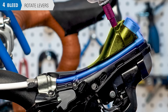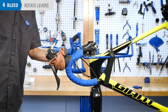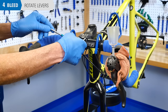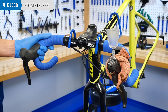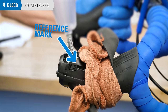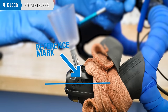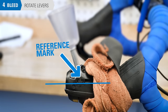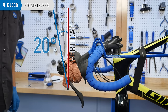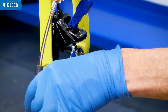These hydraulic brake levers are designed with internal channels to the fluid reservoirs. To ensure the air is fully removed or burped from the lever, it is necessary to rotate the lever to specific angles. The amount of rotation depends on the model of lever — these are described at parktool.com. When rotating handlebars, always be careful not to damage any internally routed wires. Shimano provides reference marks to align the bleed port position. For the RX810, look on the outside of the body for these molding marks — this is your reference point for the initial rotation. Rotate the bar so this mark is flat to the ground, which puts the funnel tilting forward 20 degrees from vertical.